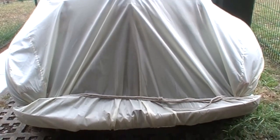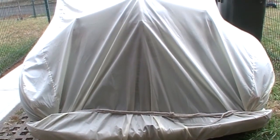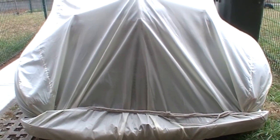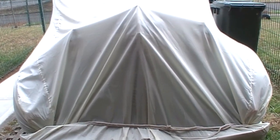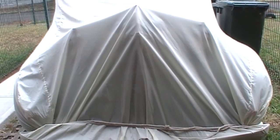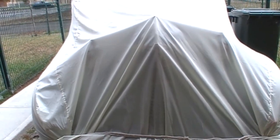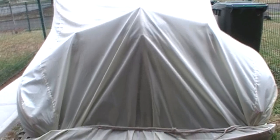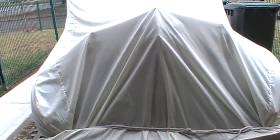So once you've got the lights turned on and activated with your memory wire on, which goes to constant power, that memory wire, don't forget, you just push that button and it will scroll through the different colours, so you can choose whatever colour you want. It's pretty hard for me to show you because they're in my car and all bolted in. But one thing you must remember is that wherever you put them, make sure that you leave yourself some accessibility around the back of the gauge, unless you can slide them in or out, to reset your colour for your gauge.